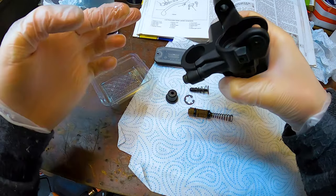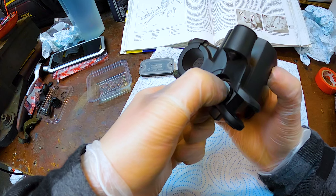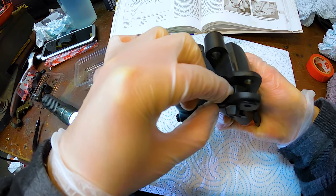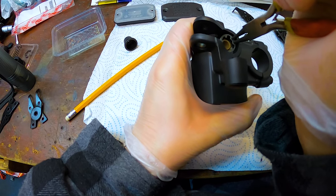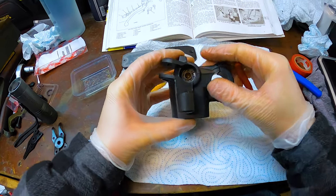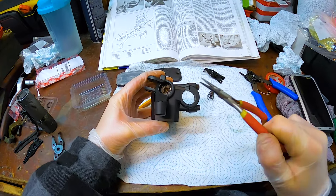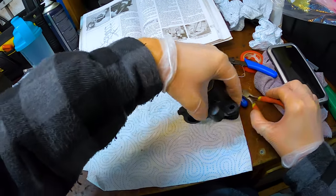Having a bit of clean brake fluid all over it. I think the only reason to do that is to stop the seal from inverting as it's pushed in, and to make it go a bit easier — obviously once it's full it'll have brake fluid anyway. Let's put a tiny bit inside there. It doesn't feel like it's sticking or anything, so hopefully it'll be all right. Once brake fluid fills up that little chamber in there, it should help as well. Right, finally — that's that in. They were a bit of a struggle so that was making it difficult.